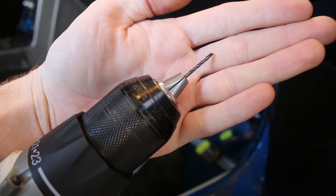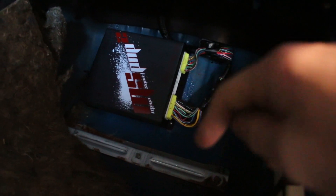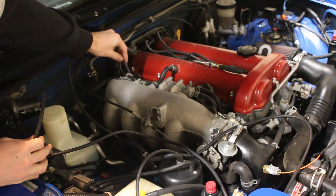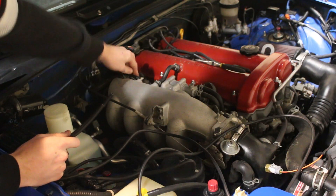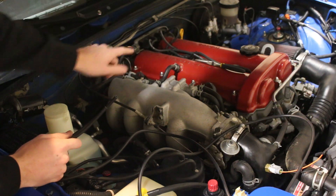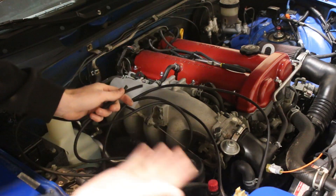This, my friends, is why you don't buy cheap drill bits. The Mega Squirt is bolted in and plugged in. Next step is to hook up the vacuum line to the intake manifold. This long vacuum line goes into the ECU and can plug in either right here or right here. I'm going to be splicing it in here because it looks cleaner. Normally you'd put it through the hole right here, but I've got AC, so I'm routing it up and around into the car.